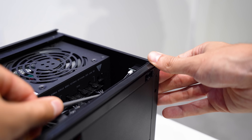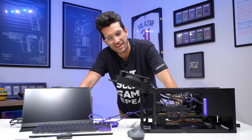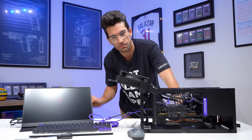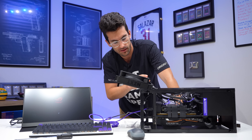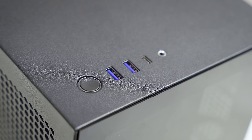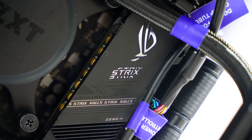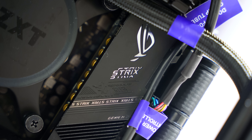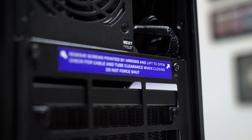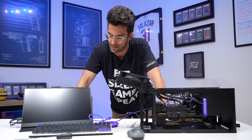Also noticed one of these front panel board screws is loose for some reason. I'm going to tighten that up so that the power button isn't as floppy. Now there is one more test I'd like to perform with respect to the USB-C connector on the motherboard. I want to know if it's the motherboard or if it's the cable running from the case. As far as I'm aware, even though we have a front panel board built into the H1, it looks like the Type-C cable is just a pass-through more or less. So there might be a short in the cable itself, or the header on the motherboard might be dead.